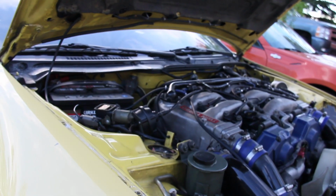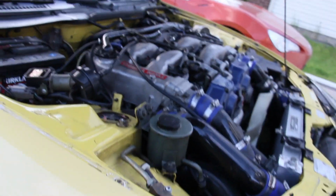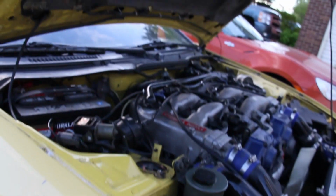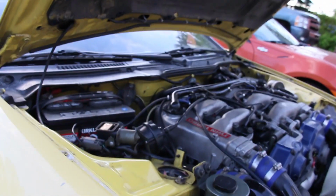Okay. But all the Z clutch bleeding videos I've seen, they said start here because it's the highest point. Yep, absolutely. And then get all the air out, then work at the slave after that. Okay, does the slave have its own nipple on it? Yeah, okay.